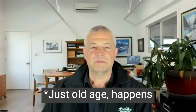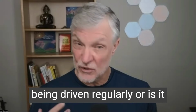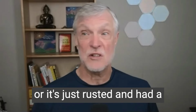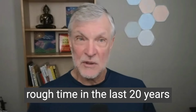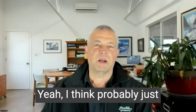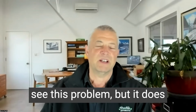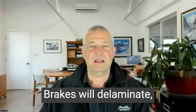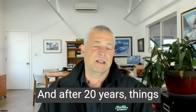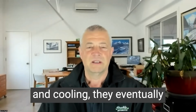Just old age. Happens from time to time. So is that a function of it not being driven regularly, or is it more a manufacturing defect, or it's just rusted and had a rough time in the last 20 years or whatever, however long since the last time it was changed? Yeah, I think probably just a manufacturing issue. It's not very common for us to see this problem, but it does happen from time to time. Brakes will delaminate, but very, very rarely. So these might well be the original brake pads. And after 20 years, of heating and cooling, they eventually need to be replaced.